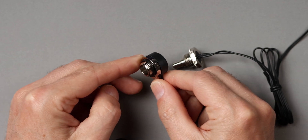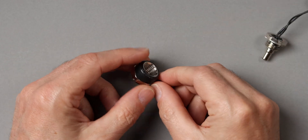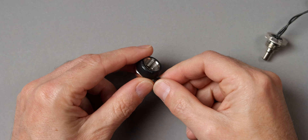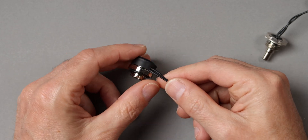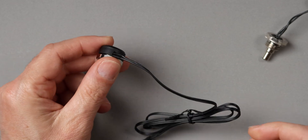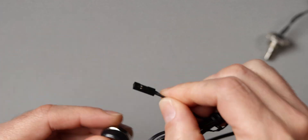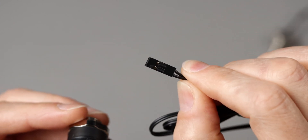But if you are using a target temperature fan controller, I recommend that you put the sensor right after the outlet of the radiator. Since the fans control the cooling effect in the radiator, you will get the most stable control of the fan speed that way. Water cooling temperature sensors are pretty standardized, so it doesn't really matter which brand you use. They are all built around a 10 kilohm thermistor. You only have to watch out that you get one with the correct connector. The Quadro controller uses a 2-pin Dupont connector. They are relatively cheap — you can get a good sensor for around 10 euros.